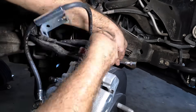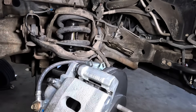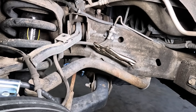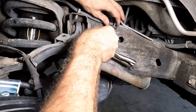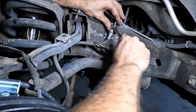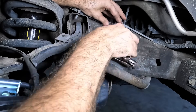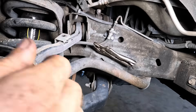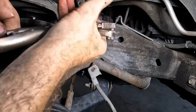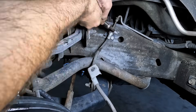This is going to run under our wheel speed sensor wire. We'll get you set up in your bracket right there. Disconnecting our line here — this one's kind of rough, it doesn't really want to come out. Perhaps it's just never been removed before. That's off. Vice grips. Let's pull this old line out of here and get rid of it. I've decided to vice grip the little clip clamp — it's easier than the needle noses, you get a good grip on it.